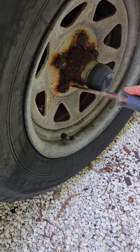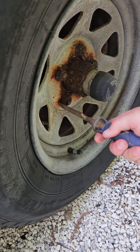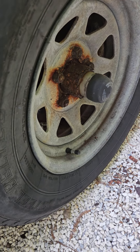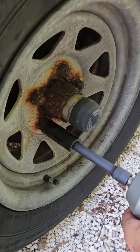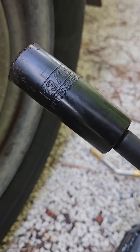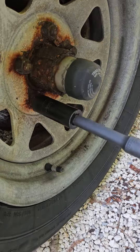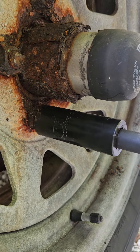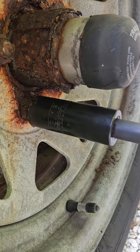And then on a couple of them we had some where the nut stripped. We actually found a solution — we've done several and it works perfectly every time. What we have here is a 13/16 socket on an impact gun. You want to make sure you get a good nice tight fit on it, go all the way to the end, and just wiggle it around to get some more of that rust off.